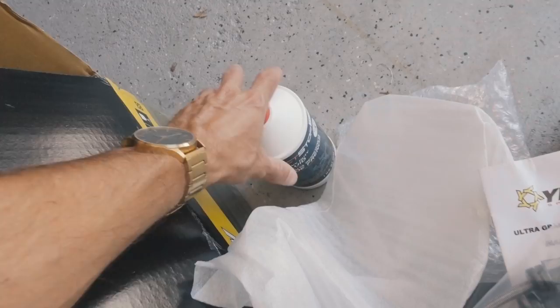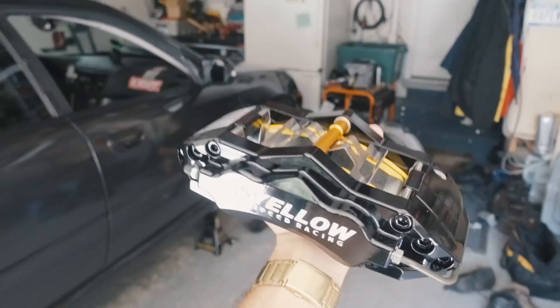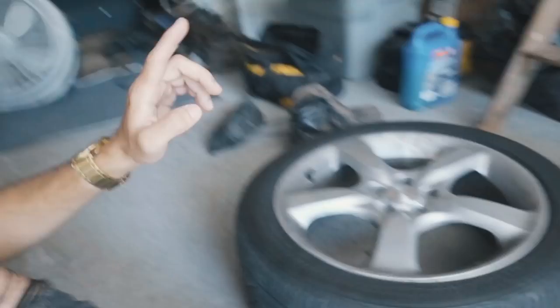The original idea with this kit was to wait until the wheels were on the car to make this the last step so we didn't scratch or ruin the calipers — they look really good. But we just want to get this done before we drop the car off in two days to get the bags installed and wheels put on. We want to bed the brakes in on our stock wheels so we don't have to worry about camber or stretched tires.